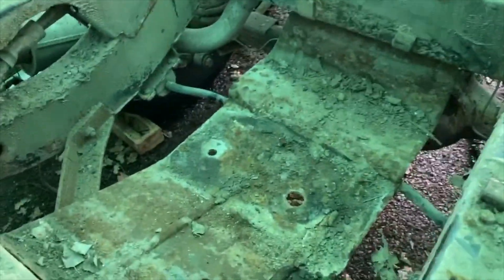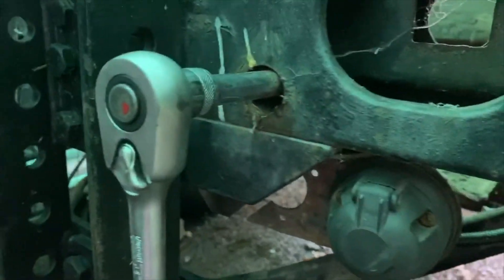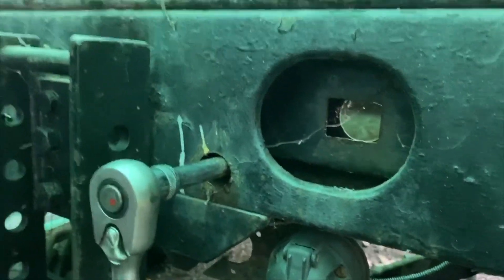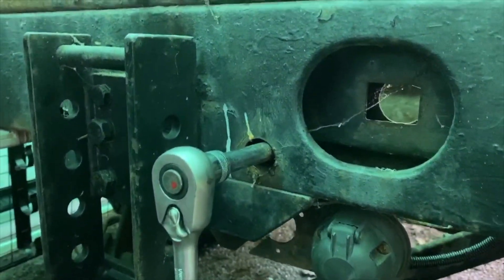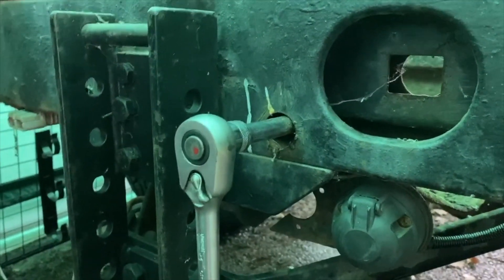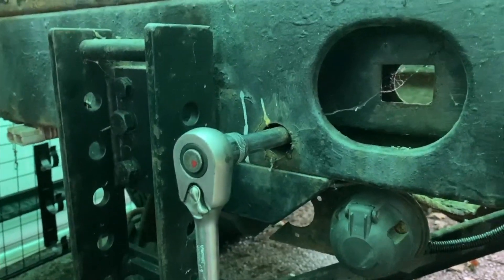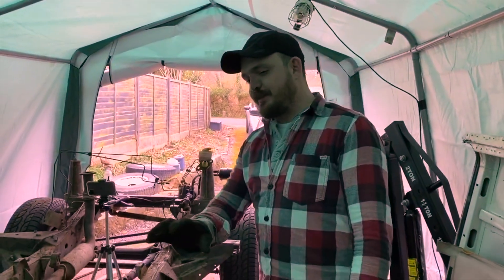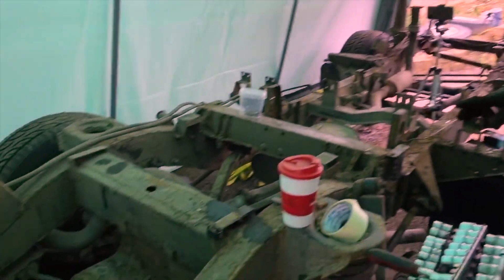To remove the rest of this carrier, there are access holes at the back for two 15mm socket-sized nuts. Ours are completely rusted — it took multiple sockets to remove the rust and eventually find that it was a 15mm that could undo it. They're very stiff because of the rust but it is slowly coming off, and those two should end up releasing this.